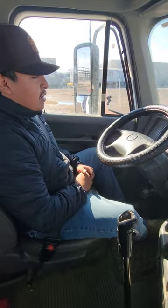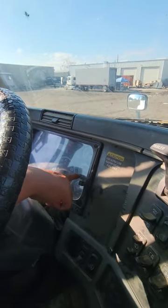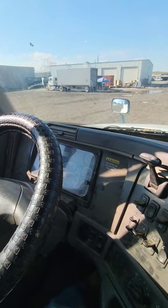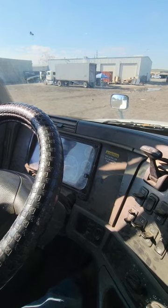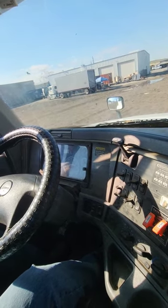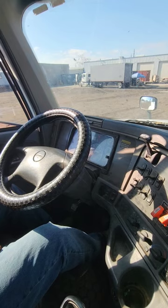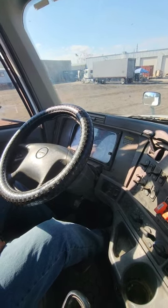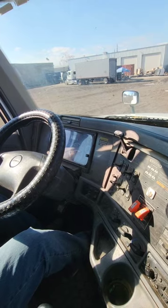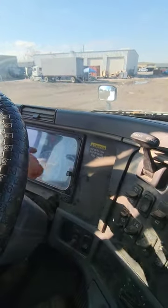Now I'm going to do my Governor Cutout. For my Governor Cutout, I'm going to race my RPM no more than 1500, build maximum pressure at around 125 psi, and my Governor should cut out at no more than 140. My Governor cut out at 125 psi. I know this because my needle stumbled to the right. My system is working properly.